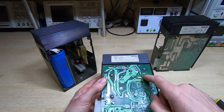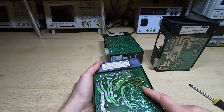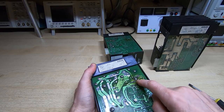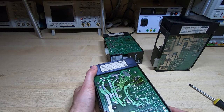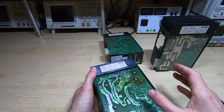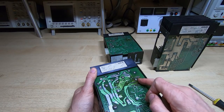Although it makes it look like the board's burning, this is the main 5V supply — this is the one that's been used most in this machine. Hopefully you can see the board is starting to blacken. It's not as bad as it looks; it is an old supply. But eventually it does cause the board to degrade, and more importantly with the device running so hot, it does eventually cause it to fail. The one I measured was a little over 80 degrees centigrade. So although I don't normally modify equipment, because I'm intending to use this machine for myself and it will get fairly extensive use, I want to make a small modification to make this device run cooler.